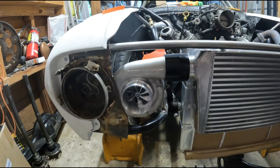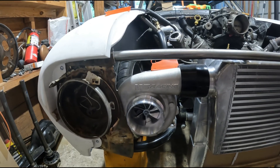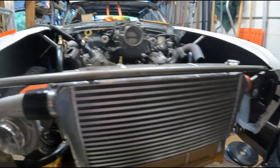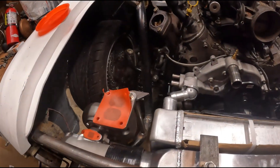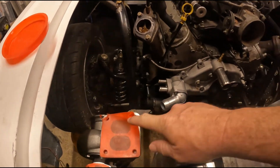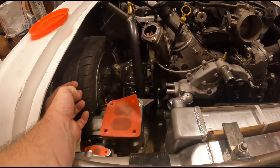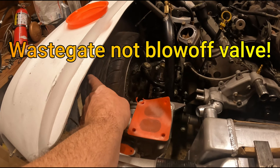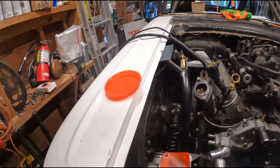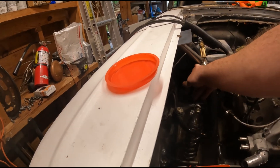Here's what we're working with. We got the turbo — it's the VS Racing 7875 Gen 2.5 with a 125 exhaust housing, billet wheel, looks pretty cool. It'll blow straight into the intercooler. I made a mount here which we'll final trim once everything's finalized. We'll come off here to here, then from this guy over to this guy. Probably put a blow-off valve right here in the merge and point it down. May cut a hole in the fender for it. Right here we should have our 4-inch exhaust, which should hopefully go up and through here without being in the way.